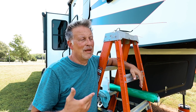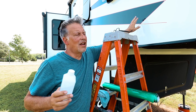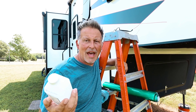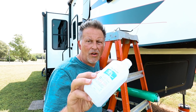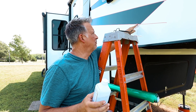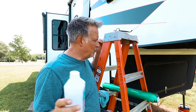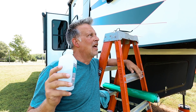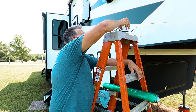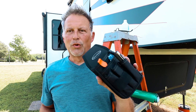So what do you start with? You take the decals that are already there. Generally I wash first to make sure the surface is clean, then I come back with isopropyl alcohol and go over the sticker and about five to six inches all the way around it. I generally do this step two times — you don't want any contaminants and you want that surface as clean as possible before applying.